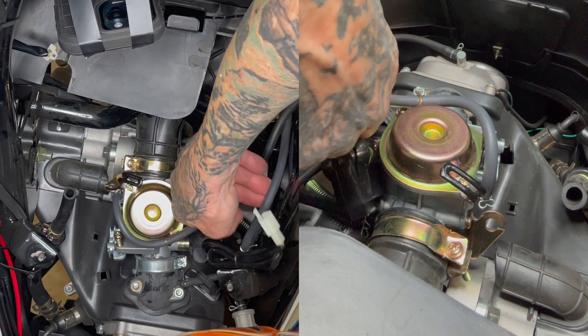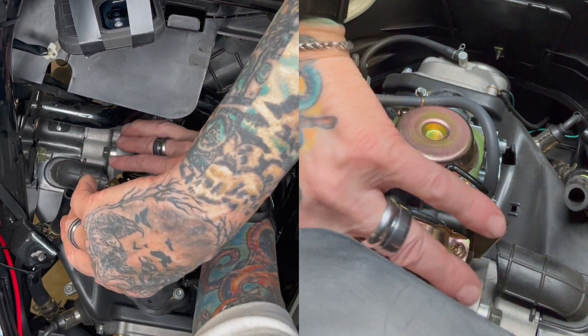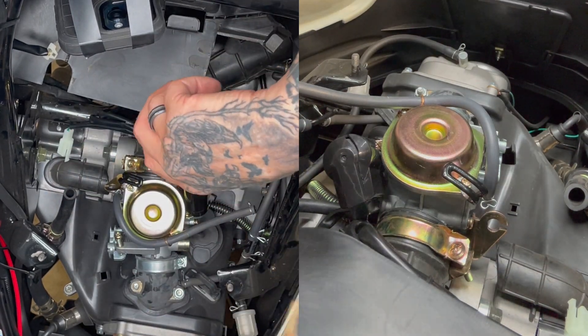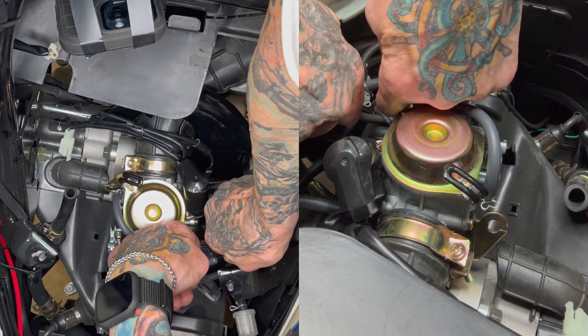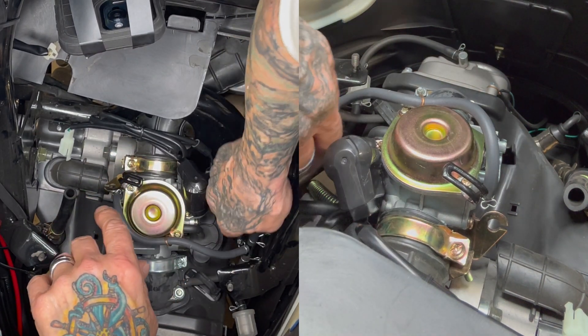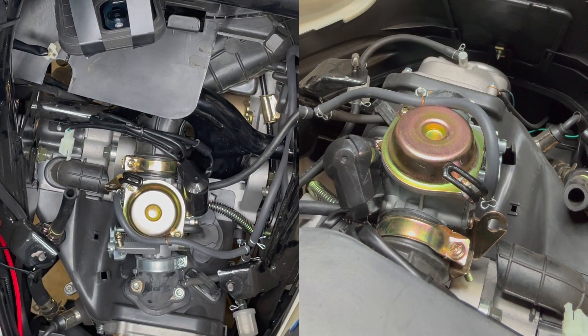Now connect your other vacuum line. Come back over here. Now that is a very important vacuum line because that also runs the choke and the fuel pump and petcock assembly. So we'll hook up the vacuum line down here. The thing is they put that drain line down there, which is very smart because when you do store it, all you have to do is drain the fuel from there because it is a vacuum assisted petcock, so no more fuel is going to come down from that point once you drain the bowl.